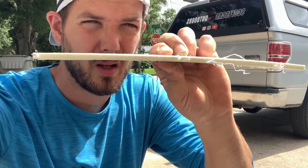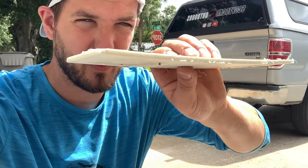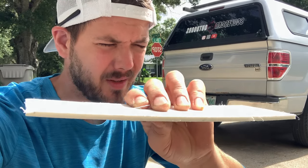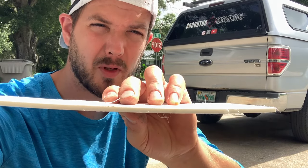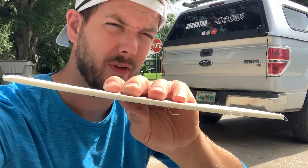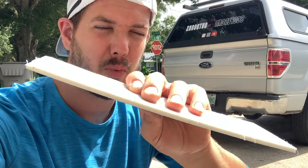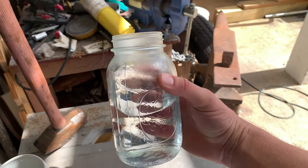I'm going to put this starboard between the frame of the trailer and the axle to help prevent the oxidation. It's actually electrolysis that's happening — the two different types of metals and the salt water are corroding it super fast. Hopefully this will hold up to what the trailer and axle put up with when I'm driving it down the road. We'll see if it starts to break down; I'll pull them out and do something different. I'm going to try these out.